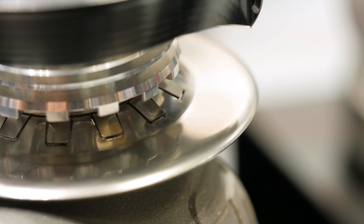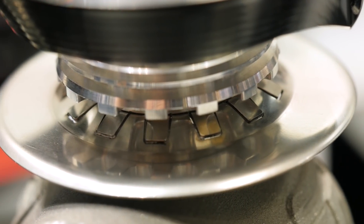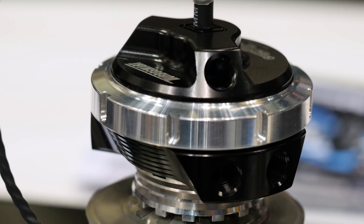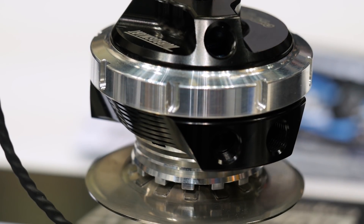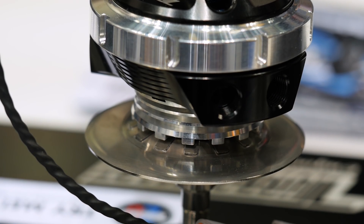Water cooling is also added to the wastegate now to help control temperature in the head of the wastegate. And if you're looking at an extreme application with a lot of heat being produced, Turbosmart also offer a motorsport specific wastegate where the diaphragm is further removed from the base of the wastegate, again helping to reduce heat transfer into the diaphragm and improve the reliability of the wastegate.